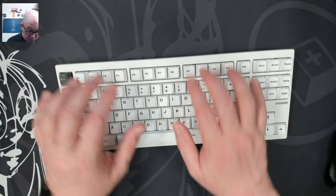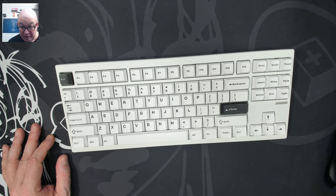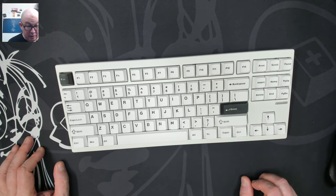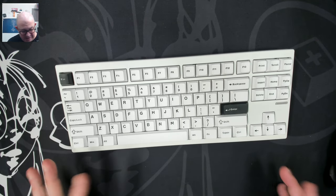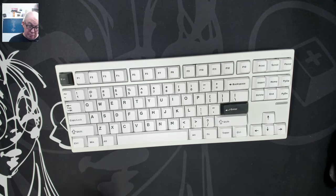So you're not going to have to worry about there being a ring, whereas the Keychron Q series, I haven't bought the latest one, but I did have the Q1 V2 or V3, I can't recall the number, even though it had rubber, the way it was built, you had to add a force break mod to get rid of the ping. And granted, they come stock with steel plates, which I just don't understand, but that's neither here nor there. With this ball latch system, we don't have to worry about doing the force break mod, because the top case, for all intents and purposes, isn't floating, but it's not directly connected or screwed into the bottom case.